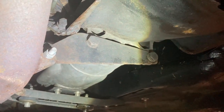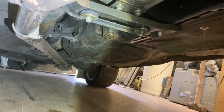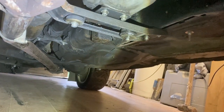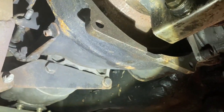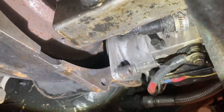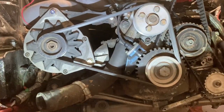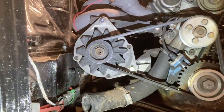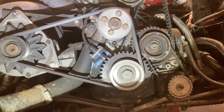Right, I presume I don't even think I need to take the start motor off. I think I can disconnect the gearbox, slide the gearbox out. So prop shaft needs to come out. Gearbox, 4 bolts, I think, and it'll slide out the bell housing. I should be able to leave the bell housing with the starter motor on the engine. I've done the dry sump, the oil cooler, dry sump pipes. It's not much interest watching that come off. So let me get underneath, get on with the exhaust, and then step closer to getting it out.